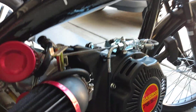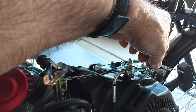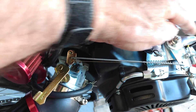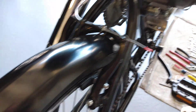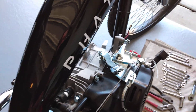The original Fatmoto throttle cable has a hook in it because it originally came around under here and went straight up to the original Fatmoto carburetor. But with this conversion to the gas bike engine, it just loops right around here, fits right into the cable stop connector. For a different Predator motor — like one from Harbor Freight — it's really easy to make your own throttle linkage using a little L-bracket. You can even make one from an old brake cable housing. There's a ton of videos on YouTube showing how to do that.